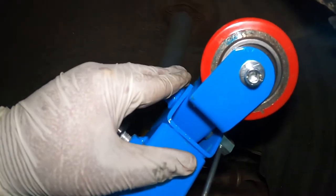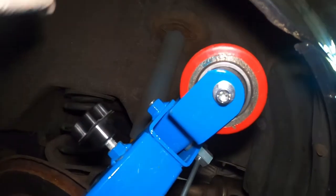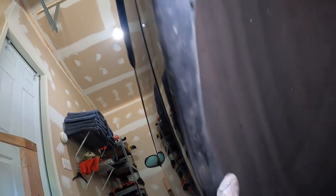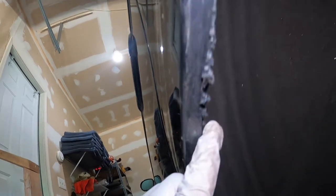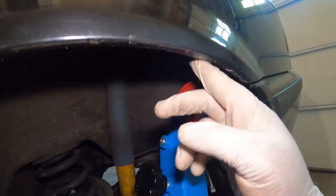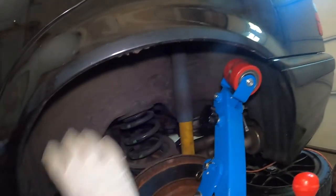You attach it here, and for the first time you put it at about a 45-degree angle — you don't want to hit it straight, you need to curve the edges first before you flatten it out. Looking carefully, it seems like the previous owner already partially rolled the fender, since it comes pretty flat then curves a little. I'm going to add more curvature to this area where my tire is touching. You put it at 45 degrees, tighten it so the wheel touches, then start doing a circular motion.